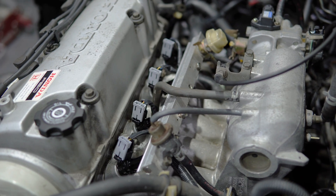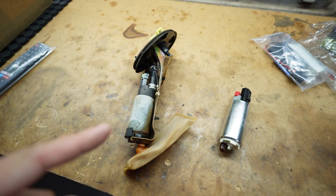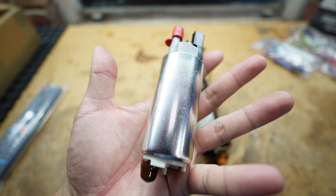We've installed our new injectors and modified the wiring to suit them. Because we're injecting so much more fuel into the engine, we need a higher flowing fuel pump. This is the Walbro 255 - pretty much the largest pump you can go to on these Civics before needing to upgrade the wiring. The 255 is a very simple upgrade, but anything over that like a 340, 460 litre, or 525 litre fuel pump, you definitely need a relay. The beauty of the 255 is it's pretty much bolt-on with no wiring needed and the connector plugs right in.